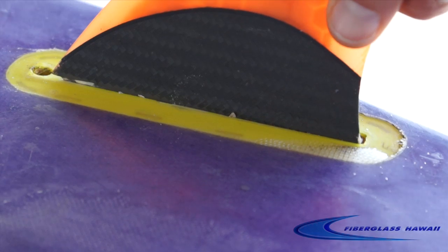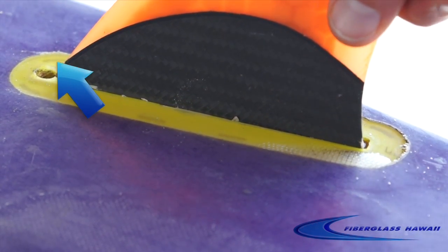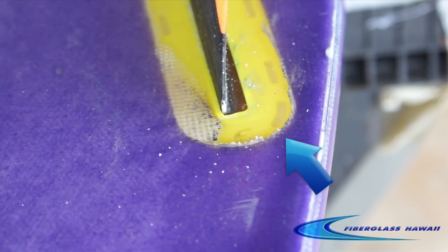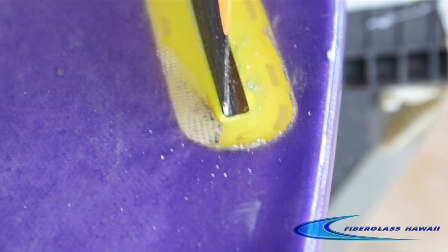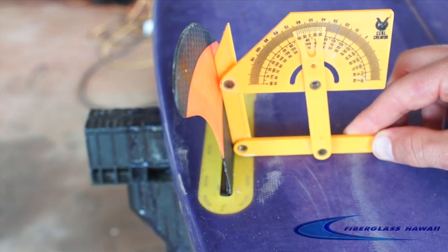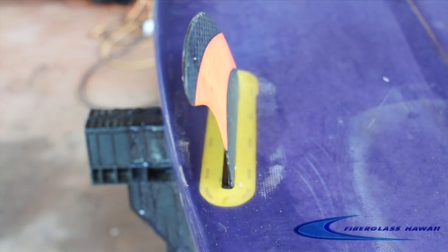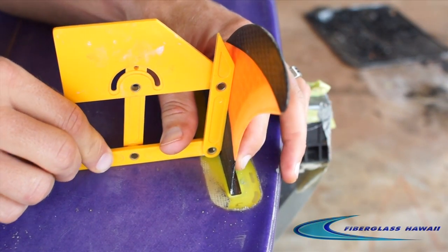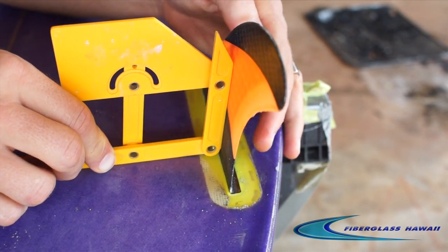However, there is damage to the front right upper side and the back side of the box. If you look closely, you can see it move. So we're going to check the other fin angle, which is about 7 degrees. This fin angle looks like it's at 7 degrees as well, so it hasn't been moved off angle, which means we can work with the box as is.